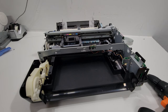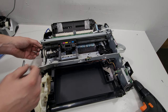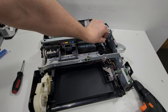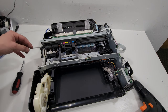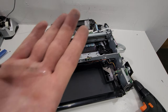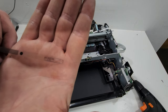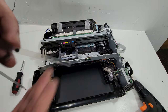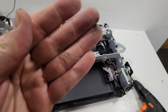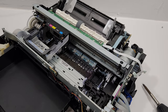Now we can see more of the inside of the printer — so if you're trying to clean or replace something, this is what it looks like. Here we have the timing strip. You need to push it to the right in order to remove it and then get this spring off. Push it to the right, remove it from that hook, and then feed it through. This one has a part number — QC3-3927. Newer ones don't have the part number on them.